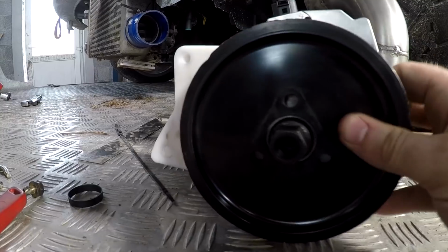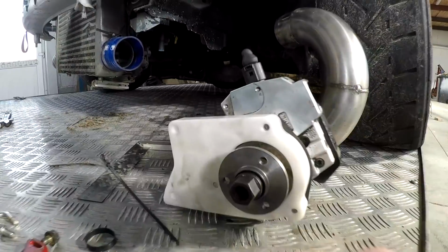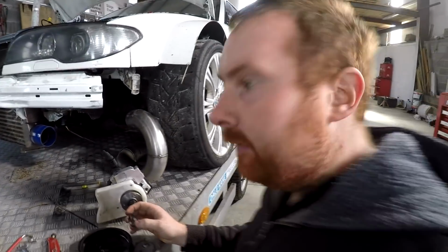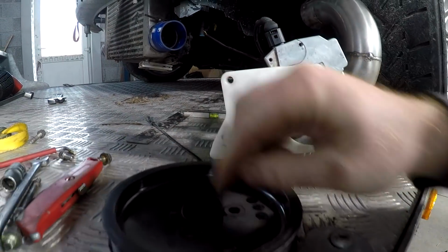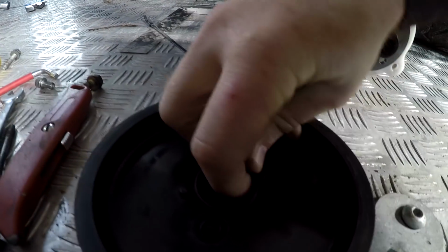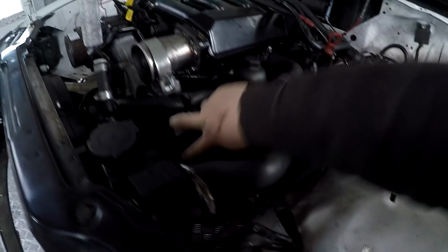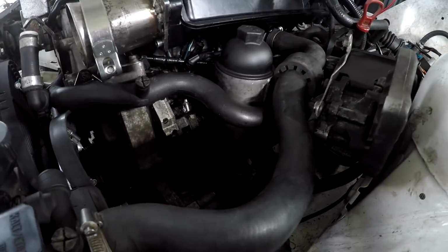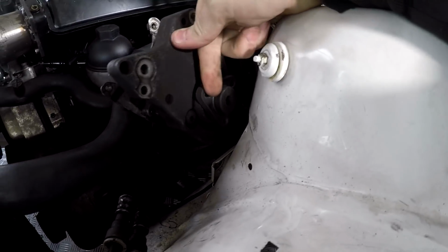And we have our PCD as well for our bolts, so there it just bolts up, if you can see it at all. The problem is, we're doing the Drift Games tour tomorrow, so I had to go and make another little Delrin insert to go back into there again, because we did widen the hole in this, so it'll center up on our power steering pump again for tomorrow, and we can see that going in there. So yeah, we need to get this car back up and running again for tomorrow. The mounting points for the CP3 are exactly where the old power steering pump was, so there and there. And that's the old mounting bracket for the pulley.